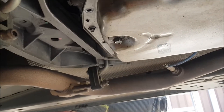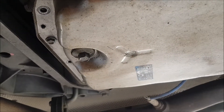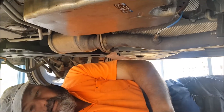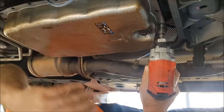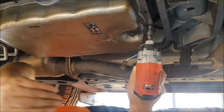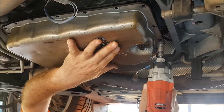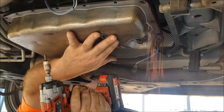It's finished draining. I've put the drain plug back in and I've undone all but two of the bolts from around the pan — just one on each end left. Just because it stopped draining doesn't mean the oil's out — it's got plenty of oil left to go. We're going to undo those bolts, and I need to position the bowl strategically because as soon as I undo this one, it's going to start leaking and pour out.